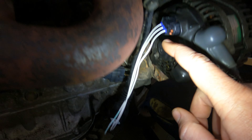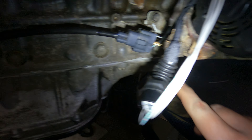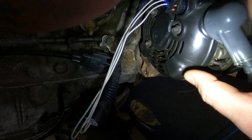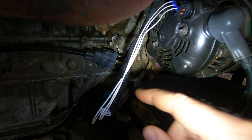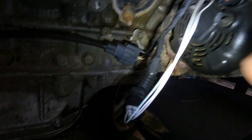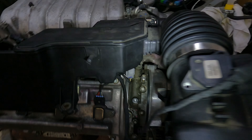Coming down here we've got your alternator plug and your lambda sensor plug. I haven't got a Crown alternator with the 4-pin plug, so I've adapted it here — but your alternator has the 4-pin plug and it's completely controlled by the ECU. I've made a little adaptation here to make it work so we can verify everything is fine.